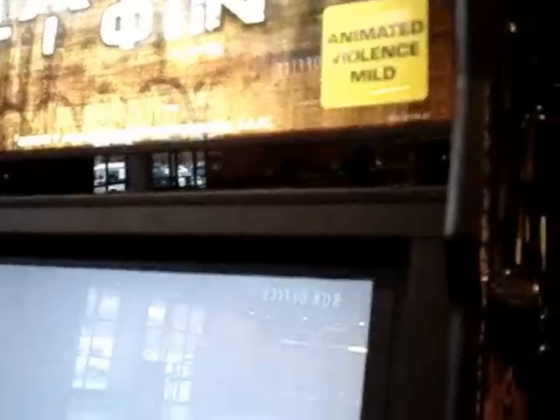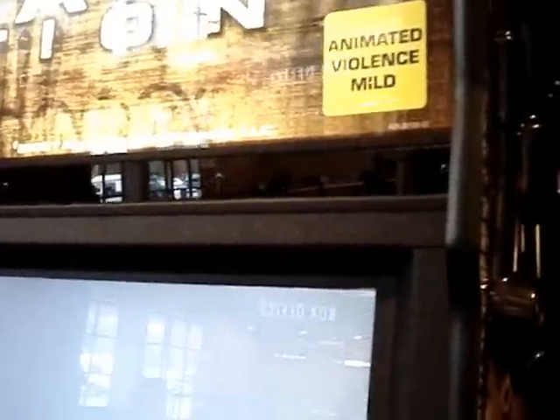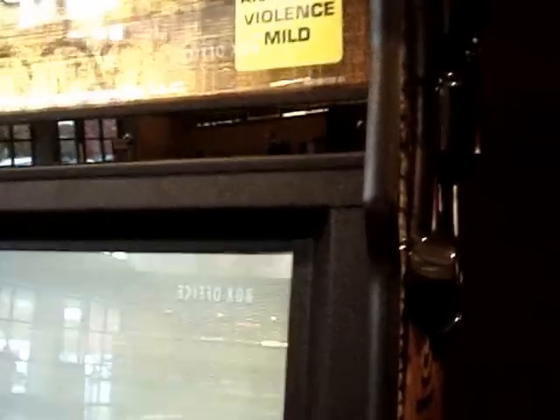It's five boards on the top and five boards on the bottom. Each board has three infrared LEDs. Now the game doesn't use all 30 of the infrared LEDs — I have a chart that shows which ones to use or not. And if we've done our job right, once it boots up and the game is in attract mode, we shouldn't be able to see any of the infrared LEDs on with the camera.